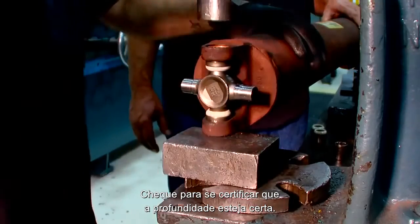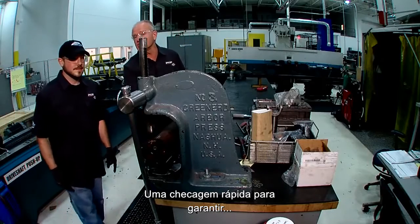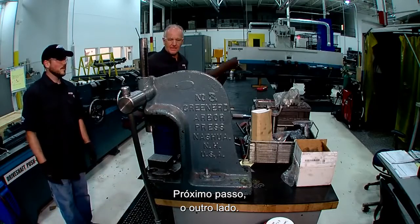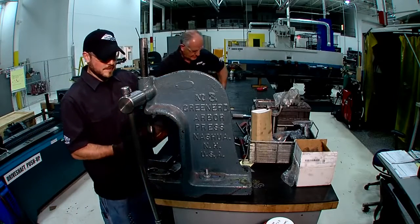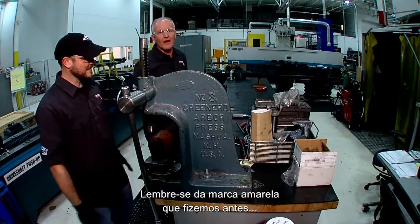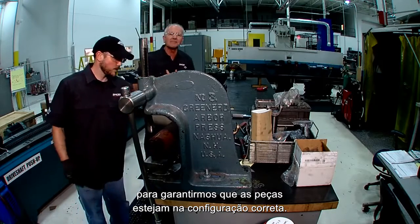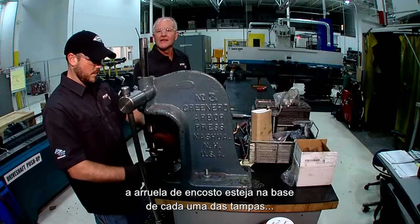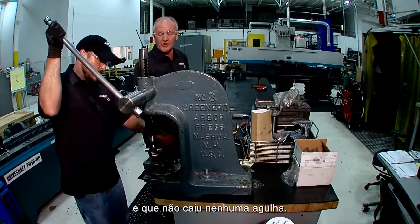Check to make sure the right depth is maintained and do a quick check to ensure the flange is not too tight. Remember the yellow mark that was put on before — we ensure that the parts are kept in the correct configuration. Notice he's checking to make sure that the thrust washer is in the base of each bearing cap and that no needles have fallen over.